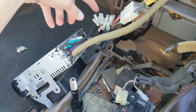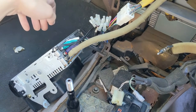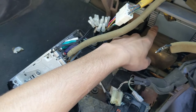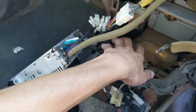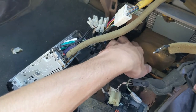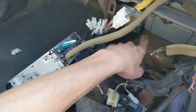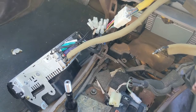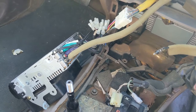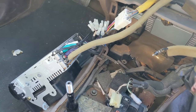You can use the stock amplifier as they've done here — this unit was installed in 2009. But I don't know the wattage of the factory amplifier, so I'm going to be installing my own head unit. That head unit puts out 22 watts RMS per channel. I've read online that some people think this is like two watts, others say about 15, and some even claim 25. So technically I might be downgrading the system, but that doesn't matter because I'll be installing a stereo with 22 watts, which is plenty of power. In about a month or so, I'm going to be getting a brand new amp at about 50 watts per channel — almost 10 times better. All this technology is from 1999, so obviously it'll be reliable, but we've had a lot of improvements in technology and sound equipment since then — DSPs and DACs. I think there will be at least a little more clarity in the system.